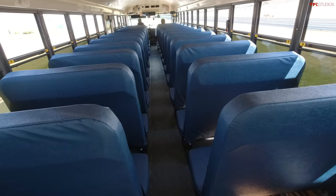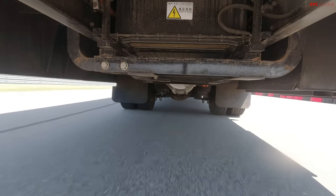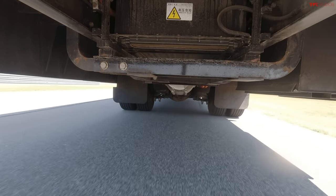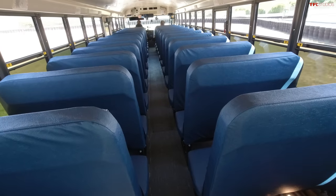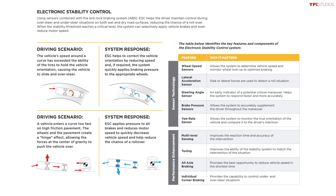There's a standard test where you drive through a gate at a certain speed, turn hard left, and try to get traction control to come on. We actually failed that test and couldn't figure out why — we were checking sensors and all kinds of things. It turns out, with the center of gravity being so much lower with the batteries in that position, we were so stable that we had to increase the speed to prove that traction control came on. It's a very stable vehicle. Even on an icy day, if your wheels started to spin, the traction control would kick in and disable regen so you wouldn't have any issues.